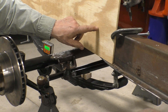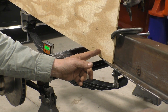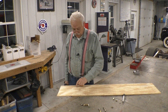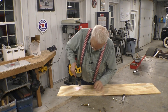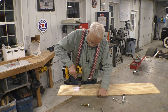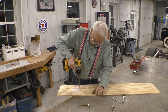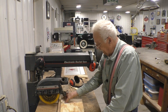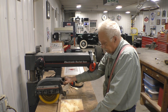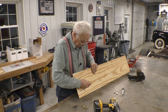Now we have three holes that correspond with the box. We'll drill these holes out and trim off the end — I only want a half-inch clearance between this hole and where we weld it to the frame. We'll drill an eighth-inch pilot hole to start, then step up to a three-eighths-inch bit, and finally a seven-sixteenths-inch bit, which is the size of the bolt. We'll cut off the excess piece of plywood so we're about three-quarters of an inch away from the rear hole. We'll take some seven-sixteenths-inch bolts and stick them in from the back side.